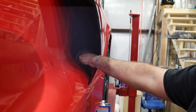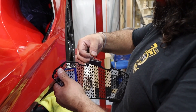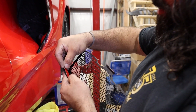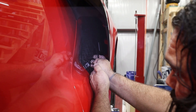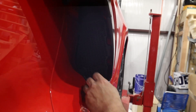Anytime you stick down double-sided tape, remember to wiggle it and press it a little. You can see with the light it's just sitting there pressed on the inside. That double-sided tape is going on the flanges of the grill — these are cut to size already from the Paragon Performance Kit. Stick it all the way to the edge, not on the inside, because you'll get a little gap showing. Now you go in, find your angle, grab it from the top, and just press in the sides of the double-sided tape. That ain't going nowhere — it is in there good.